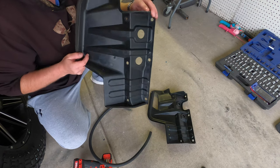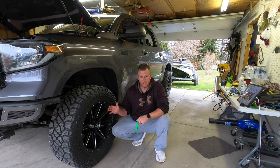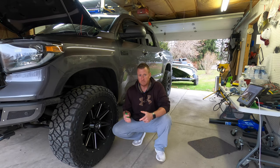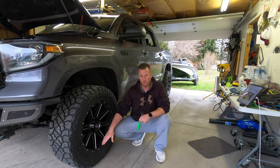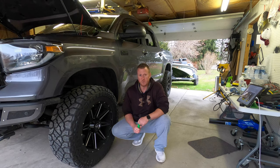Once you have that done, go ahead and replace the shroud on the truck. One thing I forgot to mention — you do want to make sure your truck is sitting perfectly level wherever you're working on it. I used a three-foot level, got underneath the truck, checked it on the frame in multiple spots. You want the vehicle to be level not only front to back but also side to side. If it's not level, do whatever you can to get it level — boards underneath the tire, jacks, whatever. This is going to come into play at the end when we check the fluid level after the install.